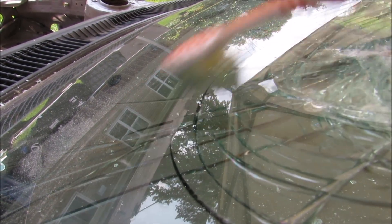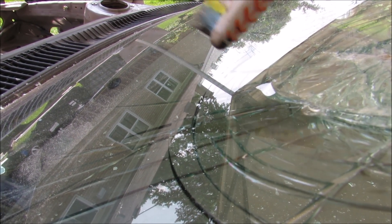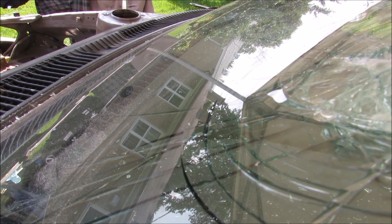The inner layer of the glass is still holding things together. Now if I just clean this area off with my brother's toothbrush, we can have a closer look at how the crack is. You'll notice that the pieces of glass are relatively large and in big shards, but it's only the top layer of the glass that's broken — the bottom layer hasn't even been penetrated.